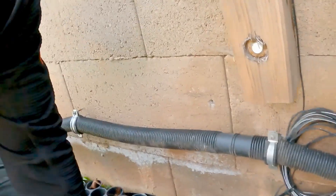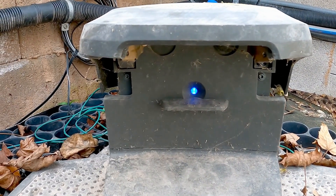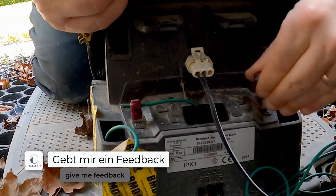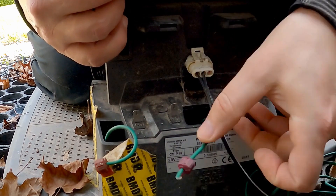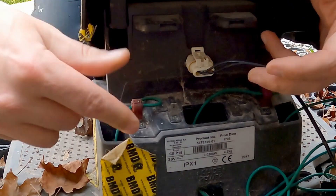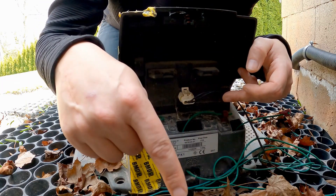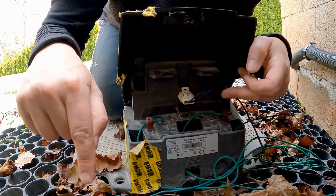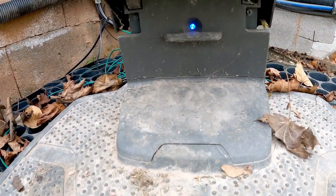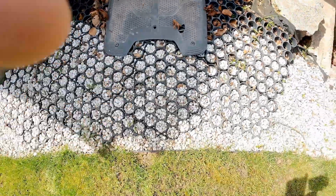To isolate the damaged cable, I remove the connection from the control cable to the right boundary cable and plug the control cable into the right connection instead. Now I have a small circle which runs along the edge of my lawn via the control cable through the middle. If I look at the display and it is blinking blue, I know that the error is in that small circle. I check the right side as well for safety — I disconnect the left side and plug the left boundary cable connection into the right connection, creating a different small circuit. Here too the control indicator blinks blue. This means the signal passes through neither of the two small circles, which is 100% proof that the control cable in the middle is damaged.